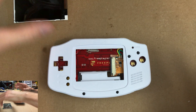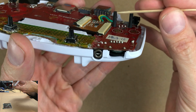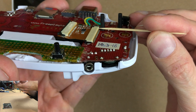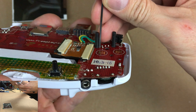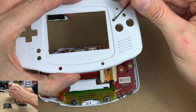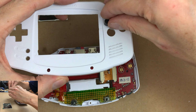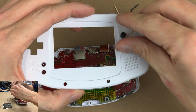I think I can get around that by cutting down the Y post to this LCD ribbon cable connector, and using something like this allen key, cutting it to size, and then fixing it to the right side of the button. Then on the outer casing it's going to come through right about here, and I can just widen this up because the button cap is going to be bigger anyway. I think that's what I'm going to try to do.